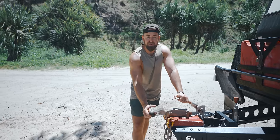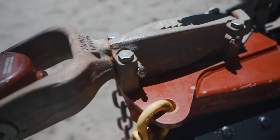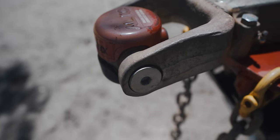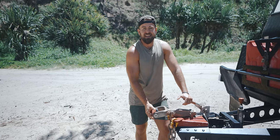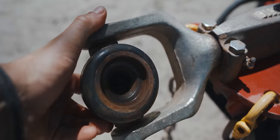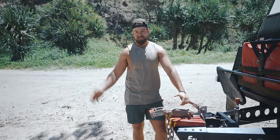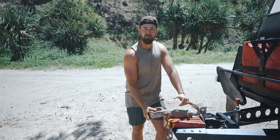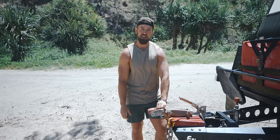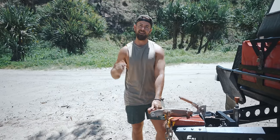This van comes with an Alco fully articulating off-road suspension hitch as standard, which has been really helpful. It allows movement both up/down and forwards/back, so the hitch does all the work on gnarly tracks and the van stays level. The hitch locks off when secure — if you want to see how to do it wrong, look at one of our earlier videos where it came off because we didn't secure it properly. When you lower the hitch down, a green piece pops out confirming the van is locked. Always press it down to reset it first; if the green is already out when you load on, it will show locked but it's not actually locked.